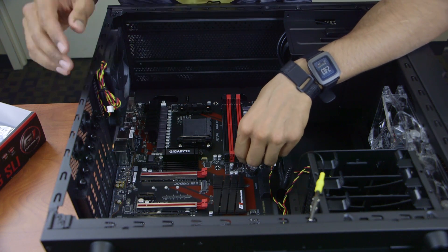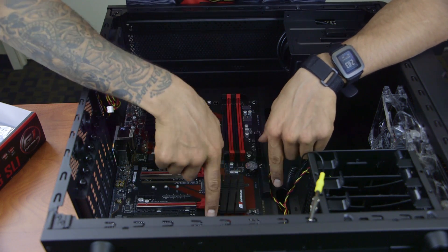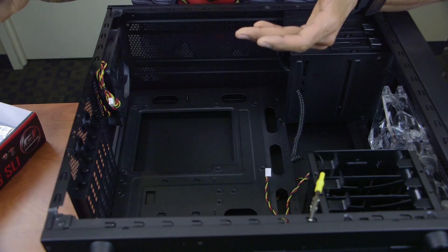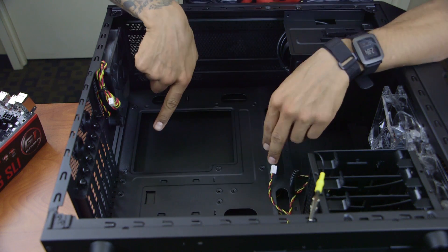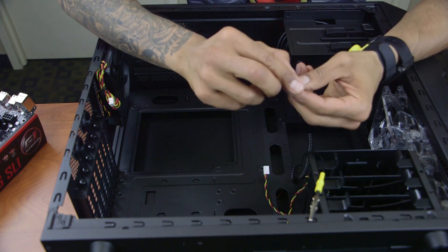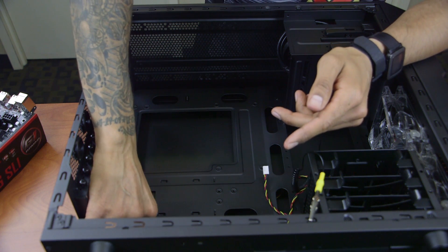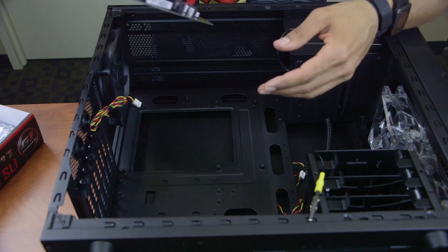The way to find the riser positions is to place the motherboard gently into the tower. I haven't put the I/O panel in yet, so I'll do that first, but I want to line everything up. I count: one, two, three, four, five, six, seven, eight, nine. I'll take the motherboard out, put it on the static bag, and insert all the risers first before tightening.